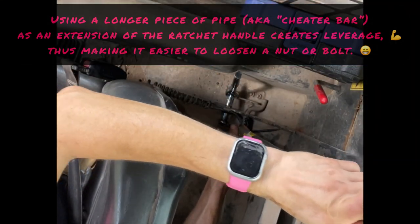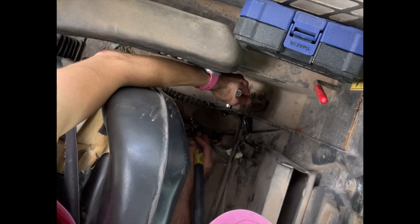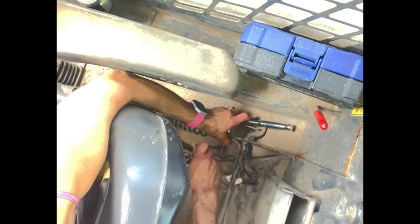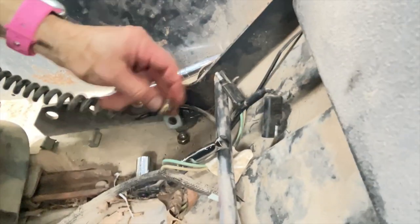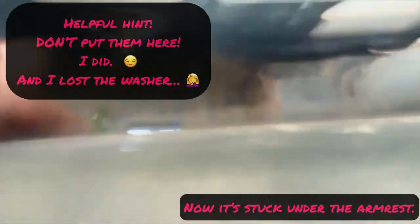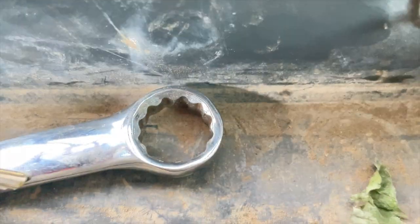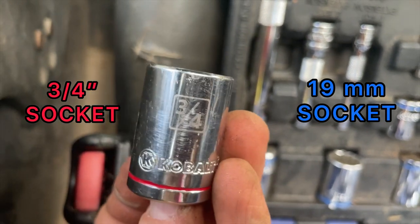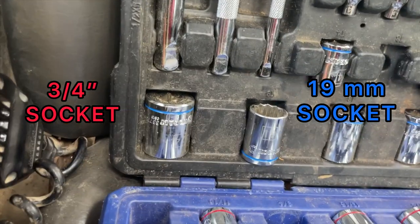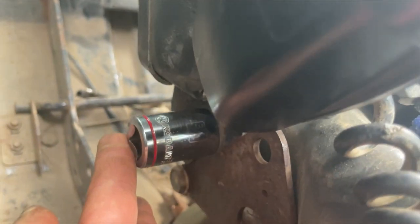This is how to give us the leverage we need. We're gonna use the three quarter inch socket — a 19 millimeter would also work. We'll take this off, take that bolt out so we can get that seatbelt part off and put the new one on.